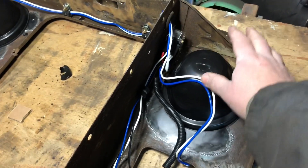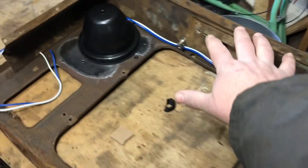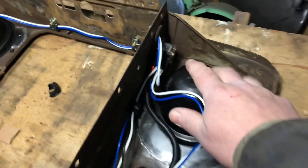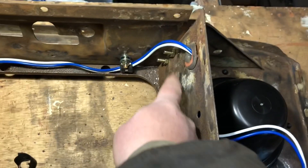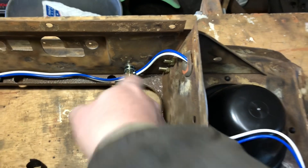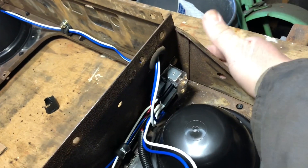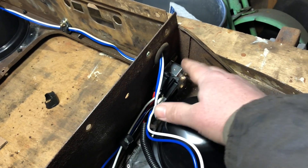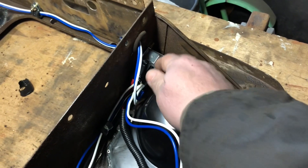Mockup and test fit on the grill itself — this is the back side. The radiator will be sitting right here. Over here is the headlight relay kit, two relays. I drilled through and put two bolts here to hold the relays in. I figure if I put it up in here, it'll be up underneath for protection from water, and no one will ever be able to see it.